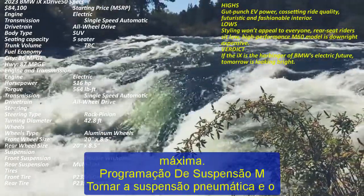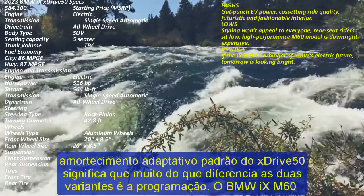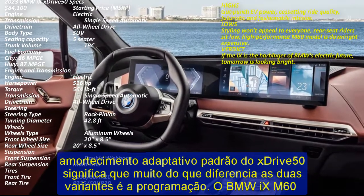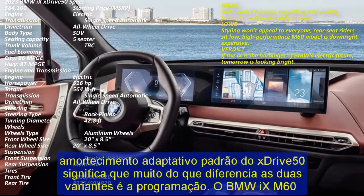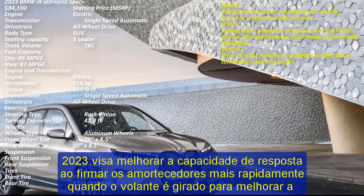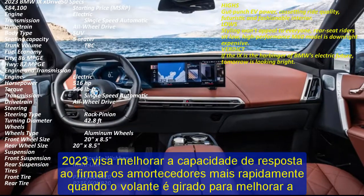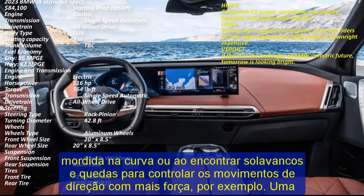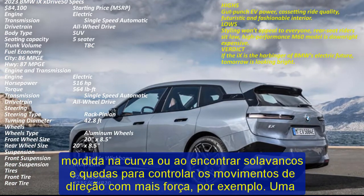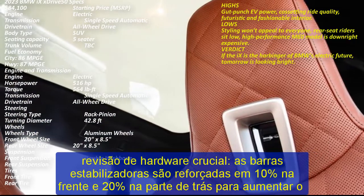Brakes and tires. The brake hardware carries over, with blue M logo calipers, but the brake-by-wire programming is tailored to suit the M mission and modes. So while pedal feel doesn't change much, the response rate delivers somewhat more bite and less travel. BMW iX M60 models only get the top two wheel and tire options from the xDrive50 design options: 9.0x21-inch wheels wrapped in 255/50 rubber, with three optional 9.5x22-inch designs available, one exclusive to the M60, wearing 275/40s. These will exact some penalty on range, which BMW estimates at 280 miles, down from the xDrive50's 305 on 21s, and 324 on 20s.